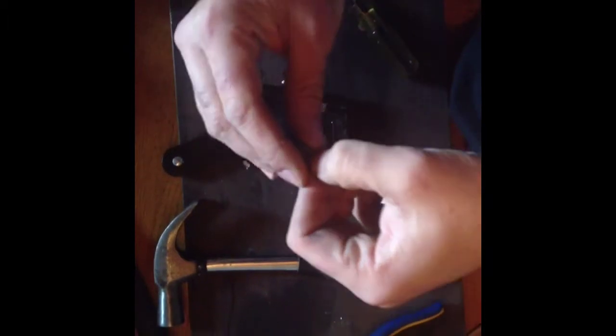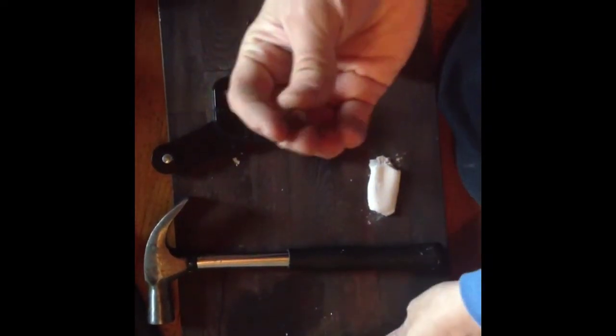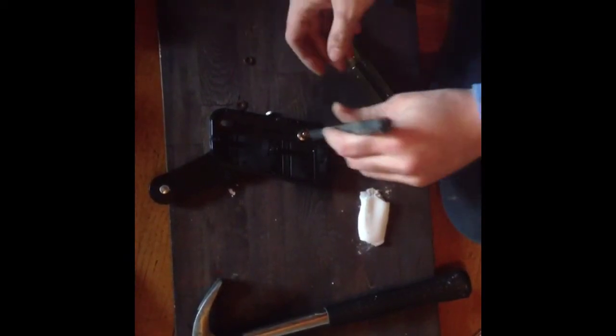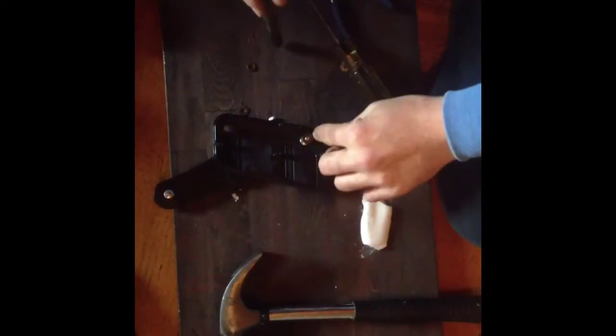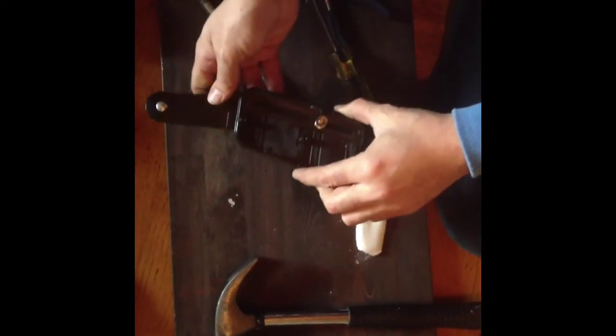Now I've been placing stoppers to fill in the groove as much as I can. These stoppers have a series of teeth that go in towards the center hole, and you need to make sure that these are straight. You need to straighten them out with a wrench before placing them on the pin and then hammering the stopper down. What I use to hammer it down is a pipe — you want one that fits as tightly around the pin as possible. When it's down, you need to use the same hammering of the pipe in order to make the teeth as straight inside the groove as possible and thus give it the necessary resistance so that it doesn't come off again.